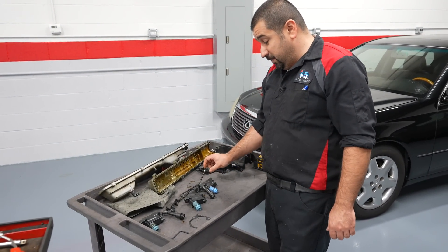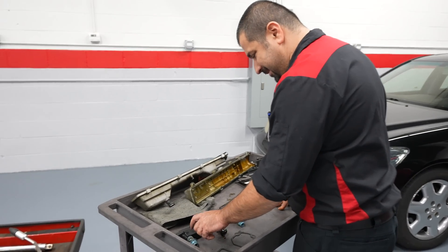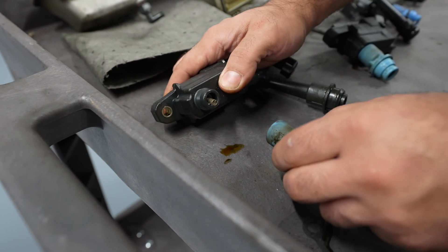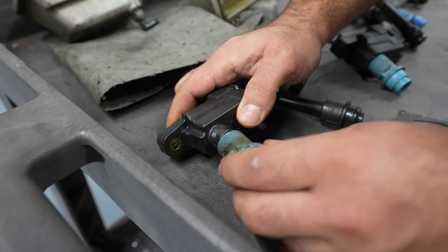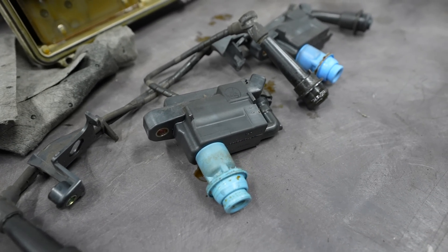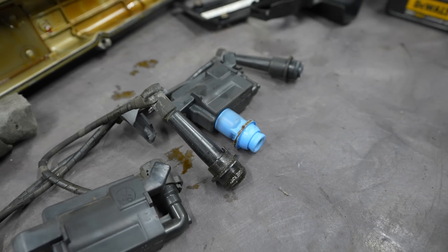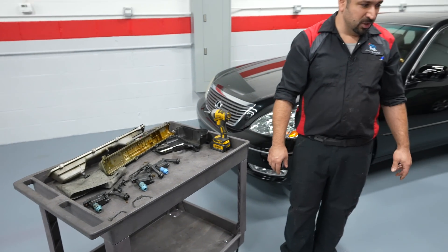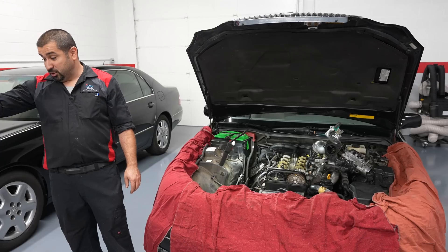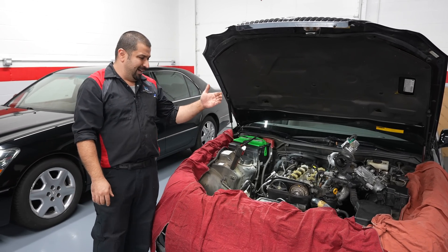My concern is we're replacing the spark plug wires — I have new wires for it, that's not very difficult. But the coils — I see oil all over the coil tube. I'm concerned about these coils. We're going to talk to this customer about the long-term plan. If we're keeping this car long — and judging by the condition of the whole car and this engine, possibly that is the plan — I would replace them. Replace the whole coil, not just the little boot, and be done with it. These are original coils, they're loaded with oil. Might as well replace them.